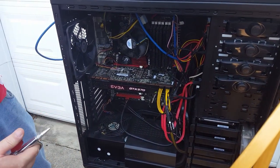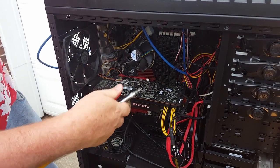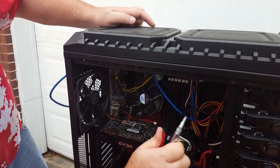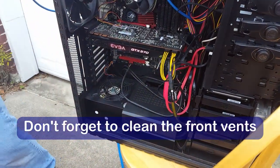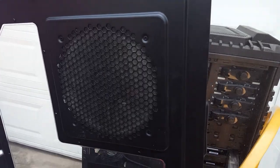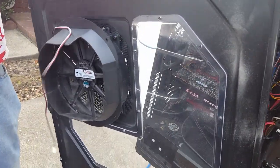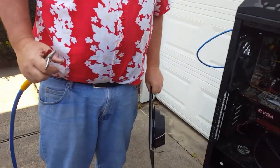The CPU overheat of course came because of all the dust that accumulated on this fan area. This additional cooler can always use a clean-out — clean it in both directions, blow out the back of the fans, the back of the vents, and of course that lovely dust bomb here. We'll get it from the front too — and that's all there is to it.